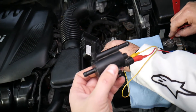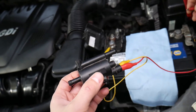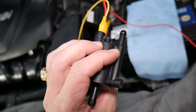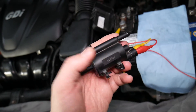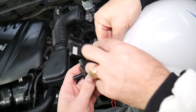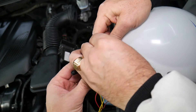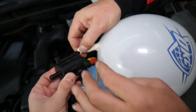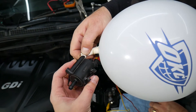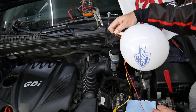You can definitely feel and hear it when you do it. This is the canister side where the line comes from the fuel tank — we have a special video that explains how to remove it. The line from the fuel tank is where the pressure comes in, and the middle port goes towards the intake manifold. It's a one-directional valve. We blow up the balloon and get it tight around the canister side so no air leaks. Now if we open that valve, the balloon deflates. When we stop, it stops deflating.